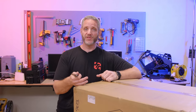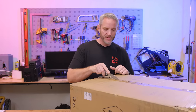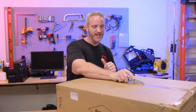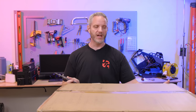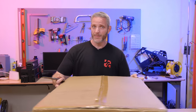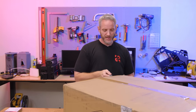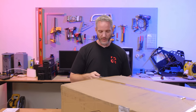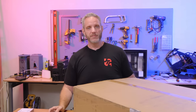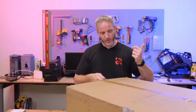So is Phil, but it would be Phil and sometimes me at the same time accessing that data. And having 200-300 megabytes per second connectivity is perfectly fine. It'll be more than that on 10G. Right now I'm stuck at about 100 megabytes because I'm still on a gigabit switch, where Phil is direct connected with 10G to the server. I am not, because the little switch that we're using now only has two 10 gigabit ports, one to the server, one to Phil. So I will be getting an upgrade personally.